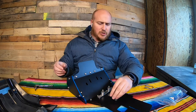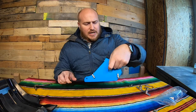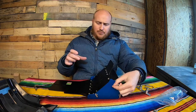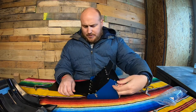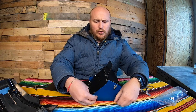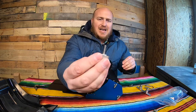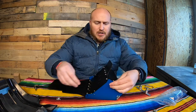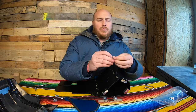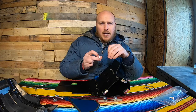The first thing I'm going to do is open up the toolbox so I can get my bolts inside the toolbox to come through and clamp onto things. When you pull your door off, you want to be really careful that the plastic washers that are on there stay on your bolts. Next, I'm going to hook up these bolts that go into the stock locations on the frame first.